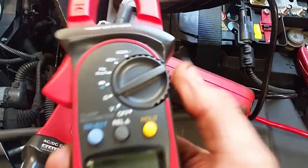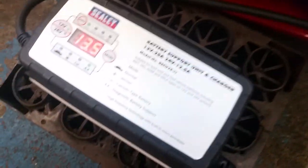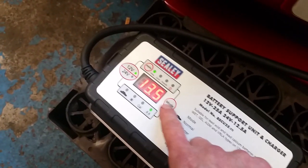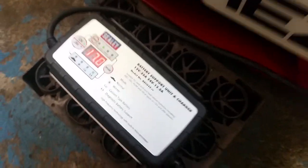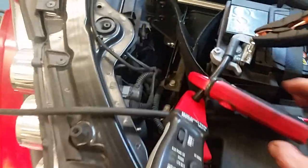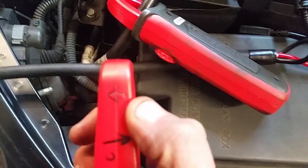Incidentally, I'm getting 15 amps here because I'm sitting with the headlights on, ignition on, and I have a battery maintainer keeping it at 13.5 volts — still drawing a wee bit of current. About 17 amps into the battery there with the ignition on and the lights on.